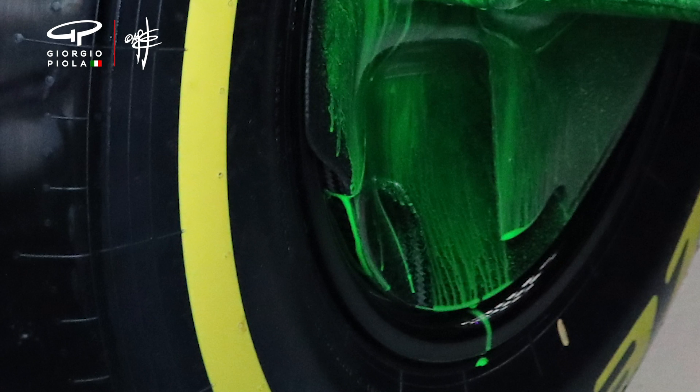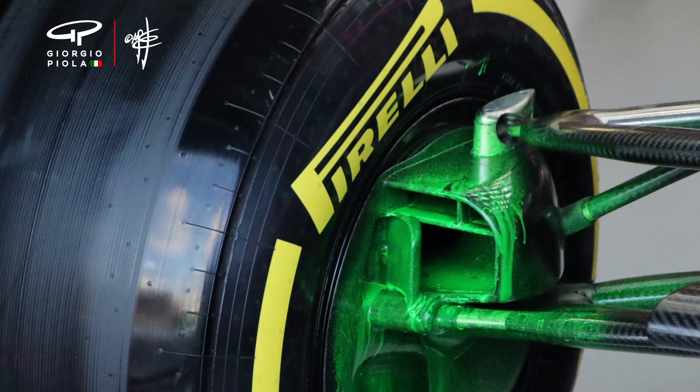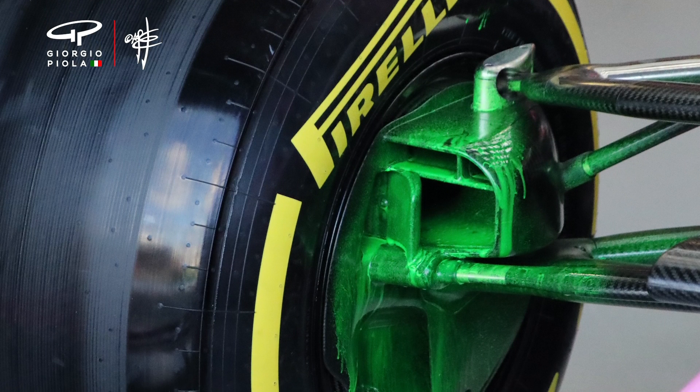There's also been a change to the brake ducts, which have been doused in flow-vis so Racing Point can get an idea of how it's actually performing. There's a very tiny little fin here and a little cutout — it's very clever. Under the new regulations, teams have had to pare down on what furniture they can have around it, so they're trying to use the brake ducts as much as possible. You're only allowed essentially a five-millimeter protrusion from the plane at the center of the wheel. By pushing the brake duct geometry in a little bit, they have a lot more space to play with — a clever circumvention of the rules, seen from Mercedes in testing and a few other teams as well. That fin is sharply angled downwards, just taking whatever flow spins off towards the center of the tire and directing it away to reduce wake.